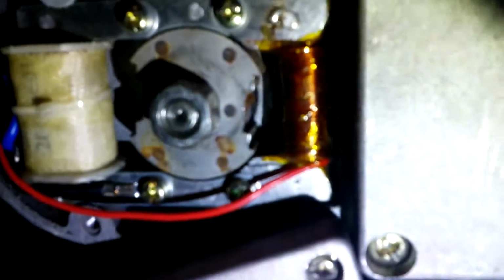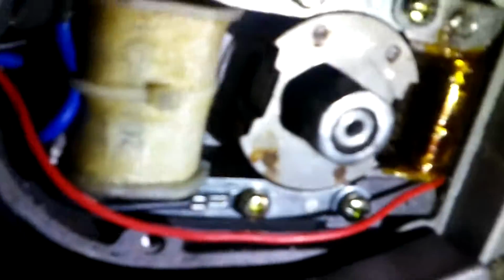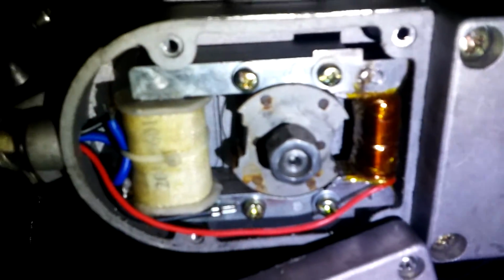Come on. See that? It's the gasbike.net gen. It's exactly what that is. There's nothing wrong with it. It produces electricity just like they claim it does. Yep, sure does. Yeah, that's the original old school magneto, the 2-wire. If you've got a white wire magneto, I suggest you get rid of it and buy just a strict 2-wire magneto. Get rid of that piece of junk.